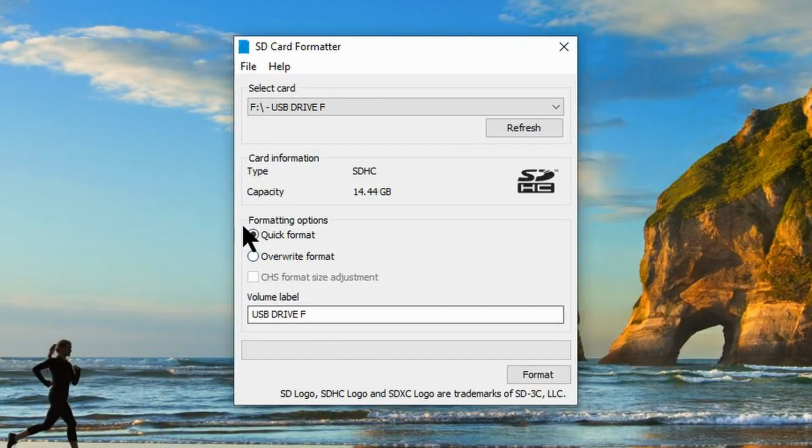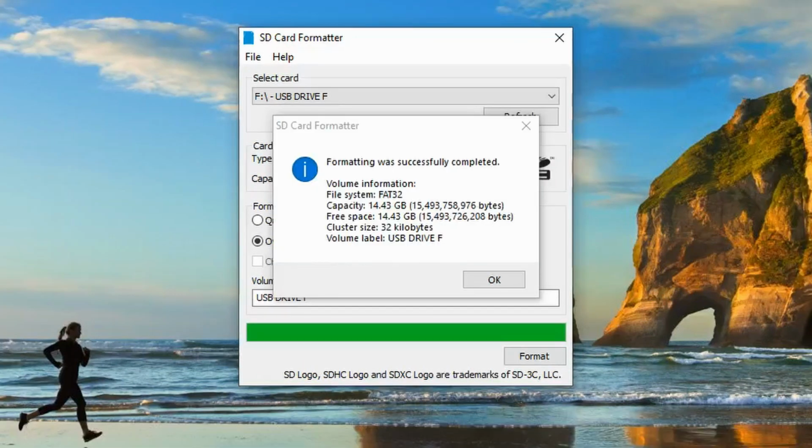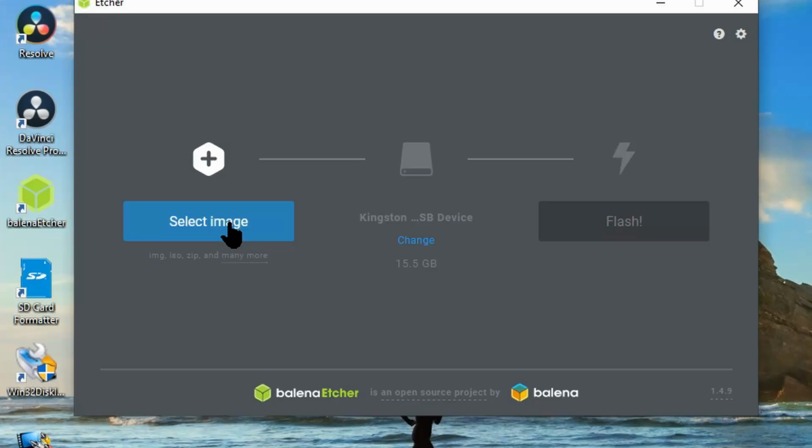I am going to format my USB stick. Link in the description for this software. If you are using a previously used USB stick, I suggest using Overwrite format. If it's new, you can just use Quick format. I always select Overwrite format, but that's just me. When ready, select Format. When finished, it will display the file structure, which is FAT32. You can see here it's supposed to be 16 GB, but it never seems to show the correct volume size.